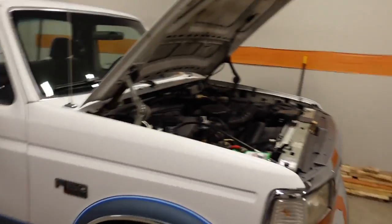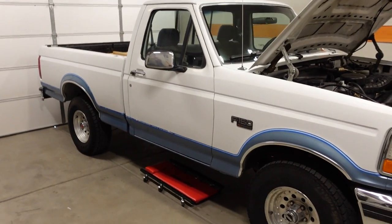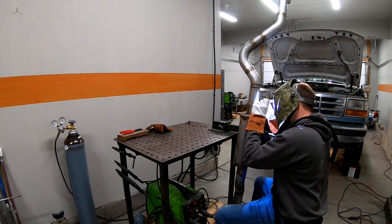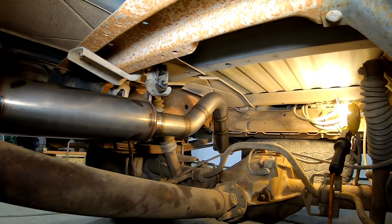So we're doing another customer build. We're kicking it off today. If you're a subscriber to the channel, you'll probably recognize this one. It's a 93 Ford F-150. And the project we did on it last time is we built a custom exhaust. We went 2.5 inch into single 3 inch. We put a Venom 250 muffler on there. Sounds pretty cool, I think. It's a single cab short box, 4-wheel drive.